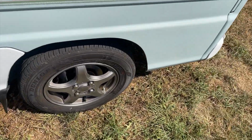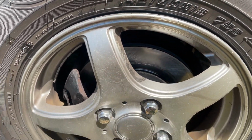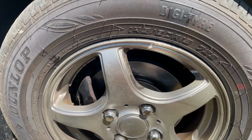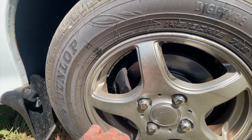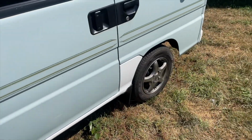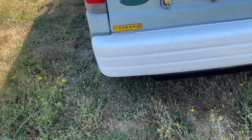It came with these cool looking wheels, little 13s. I did new rotors, Jokiko rotors from Japan, with Pit Work pads up here. I don't remember if I said, but the old rotors were pretty much down to minimum thickness, and the pads were gone. So it's time for new rotors and pads. No tricks to that. Very easy to do. I made a video. Just make sure you inspect your sliders and boots and keep everything clean and grease stuff up if you need to.